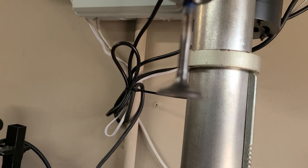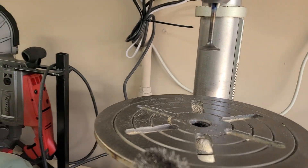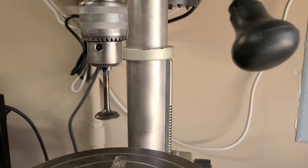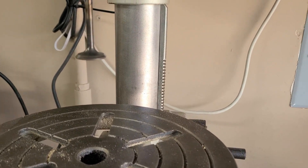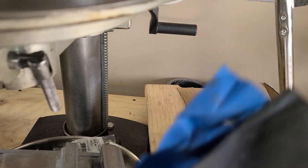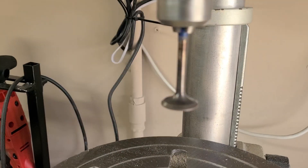Next step is cleaning up the valves. It's easier if you chuck the valve into a bench drill or a hand drill, put some tape on the end so it doesn't get scratched. I used a wire wheel to clean it up, then I'll use 80 grit sandpaper first, then 180, then 400 grit to sand down a little bit and increase airflow.